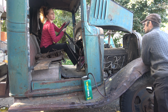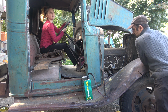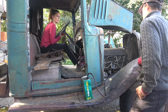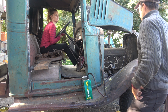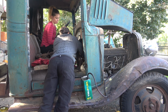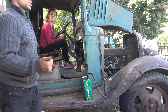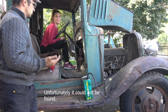You hear that? That was the starter running, but not engaging. Which isn't extraordinarily weird because it's so dry. Just touch it again, but not for as long. With the clutch in? Yeah. Don't let it rev up so high. Just touch it and then stop. Okay, and then do it again. All right. So the drive, I think it's called a Bendix, is sticky. So keep the clutch in. So what that means, the starter has to come off and I have to loosen it up. So plan B would be the hand crank method, which I don't mind.